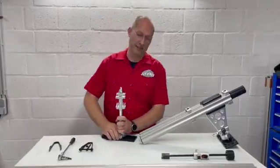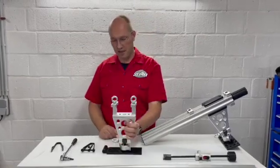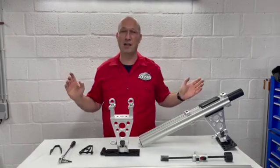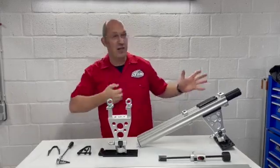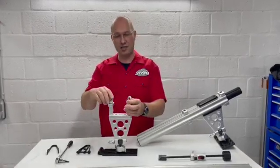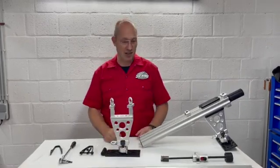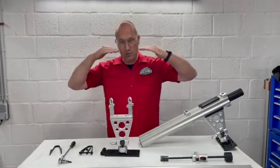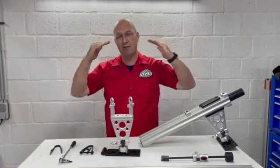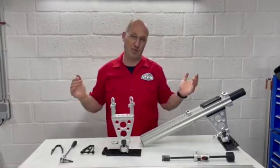Why do we think these ball feet are so important when using lateral tension? Lateral tension has been around for 50 to 60 years in collision repair — guys pulling with chains is lateral tension. What is new is using GPR — glue pulling repair — in lateral tension, and that has been evolving fast. But if you use fixed tabs and push on them, you've heard online that a lot of guys complain about tabs diving into the metal, making dents where the tabs are glued.